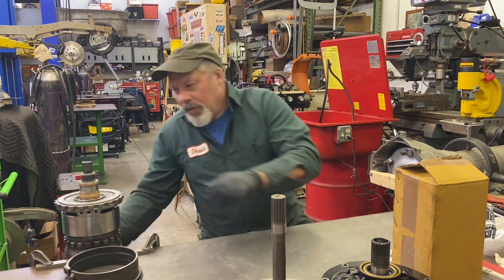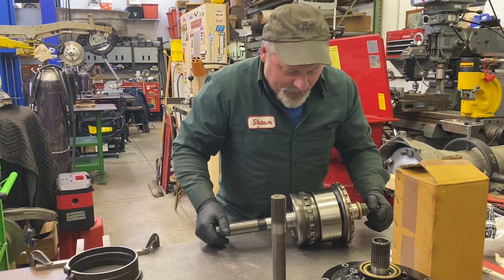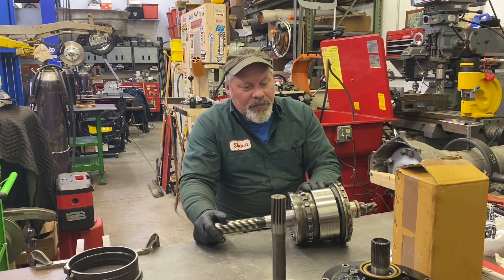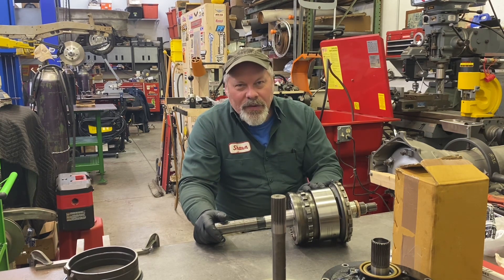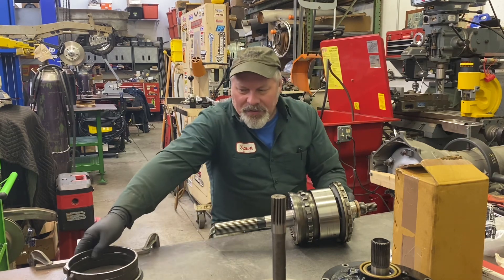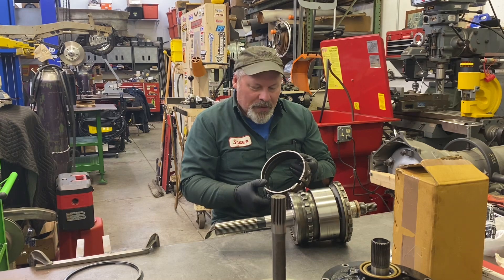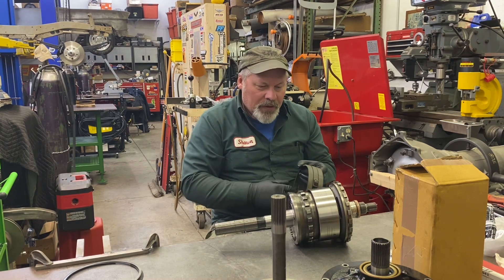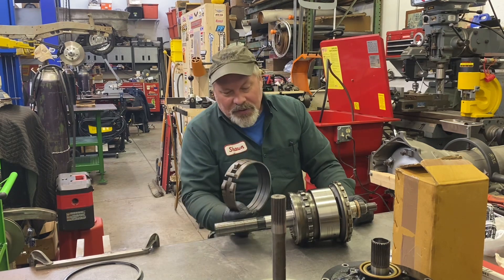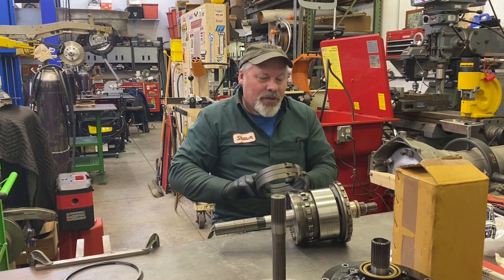The lower unit itself I've been saving as well. When I pulled it out of the core, the reaction carrier where the band rides was smoother than I typically would run, but the band itself was also in perfect shape. It's an aftermarket band, OEM style, but a lot smoother. I'm going to try this. I'm a fan of the stock band, but this transmission didn't even look new outside, but the insides certainly did.